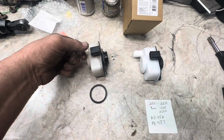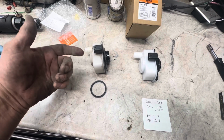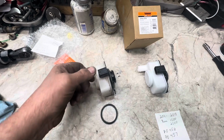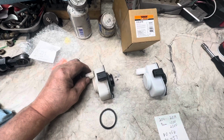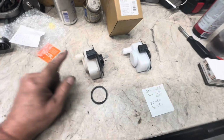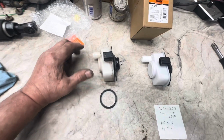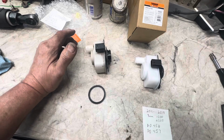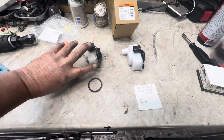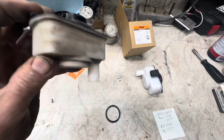What you want to do is squeeze the electrical connector terminal. It's actually the easiest terminal and connector ever for a Dodge, Chrysler, whatever product. Squeeze it, release it, and then you've got your vent tube holes right here. Get that hose off and out of the way, and then you can stand on a little ladder or something underneath it. Get your left hand up there, go underneath, get your finger in there, and push in this little tab.